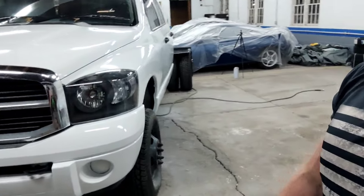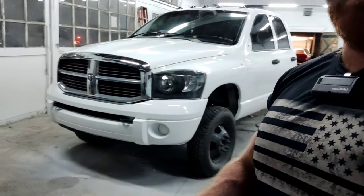That wraps it up guys - it's a $180 paint job. I haven't bought the Speedocoat single stage in a while and it did go up in price, but we got the $189.99 high gloss single stage white kit from Speedocoat and had about $10 worth of usable material left over, so technically it's a $180 paint job. For how rough this truck was, I'm really happy with how it came out. It's not perfect - you can definitely see some imperfections under the paint. However, single stage is notorious for - and I even learned this in auto body school - being great for projects like this: rougher cars, since the paint is thicker and it's made to fill in some of those imperfections.